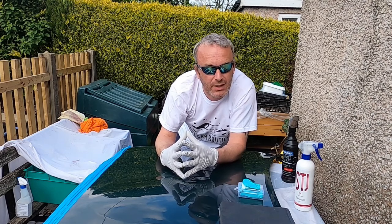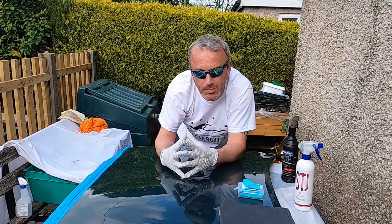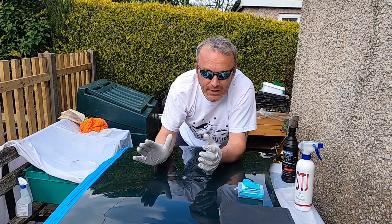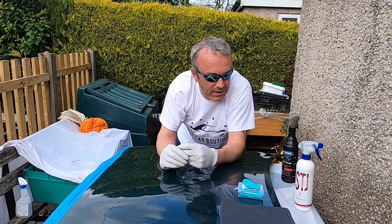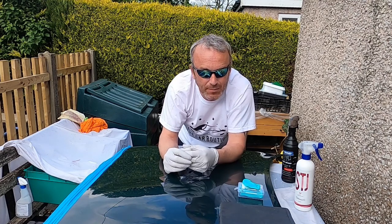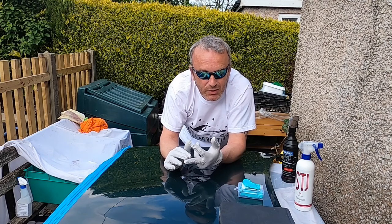That applies to many spheres of our life. The more lube, the better. And in this case, never a truer word has been spoken. All right, as soon as you feel it sort of dragging, okay, get some more lube down. I personally use dedicated lubrication clay lubes because they've been designed for that purpose. Shampoos weren't, detailing sprays weren't, water certainly doesn't, okay.